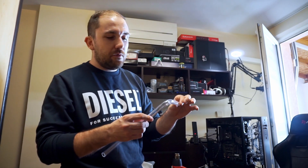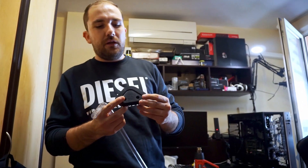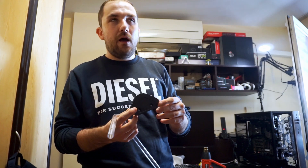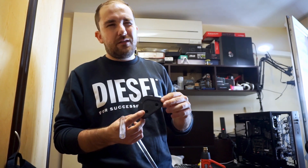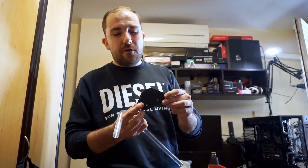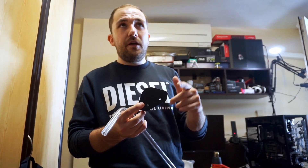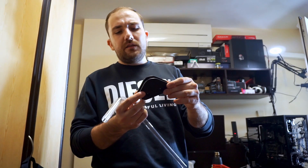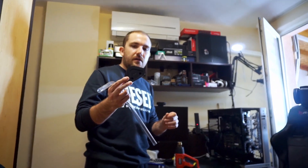When you see the pipe starting to bend, heat it a little bit more and then do the bending. I would also recommend using molding kits you can get from Aliexpress. There are also ones sold by Alpha Cool, Thermaltake, and EK Water Blocks, but they're quite expensive. I recommend buying a set by Bixkey from Aliexpress — a set of three: one for 90-degree bends, one for 45-degree, and one for 180-degree. The set of three is around five bucks, very accessible.